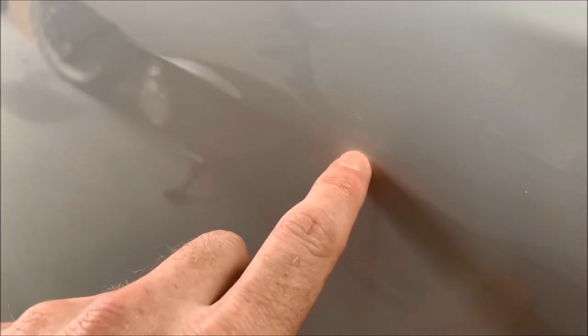I'm done using the dent puller by itself — I've done it about 15 to 20 times total on both dents. This top one came out great, I'm really shocked. It's obviously still there but compared to what it was, it turned out so good. On the bottom dent there's just a small low point below the natural body line and one small low point right above it. I also thought there was paint missing but there wasn't — the tight creased dent just gave that appearance. I'm going to order a dent light or line board to help see high and low points better, and I'll be back in a couple of days.